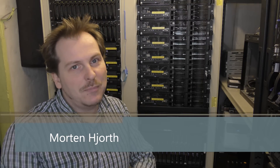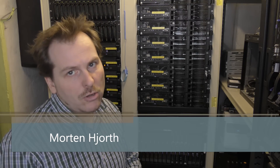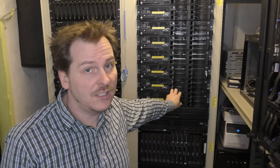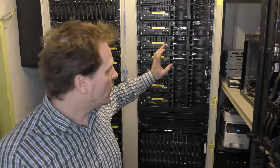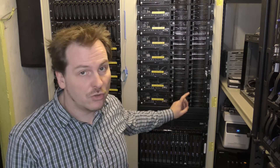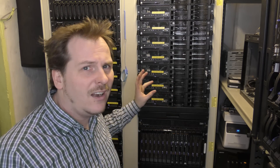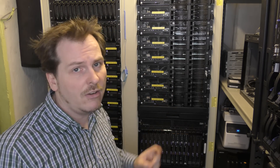Hi and welcome to my playhouse. Today I have a little experiment to do because I have all these IBM x3650 model 1 servers. They all have six 3.5-inch hard drives on the front and they are all limited to using two terabyte disks — that's the RAID controller's fault inside the server. So I want to show you that, and I'll tell you what it is that I'm up to.